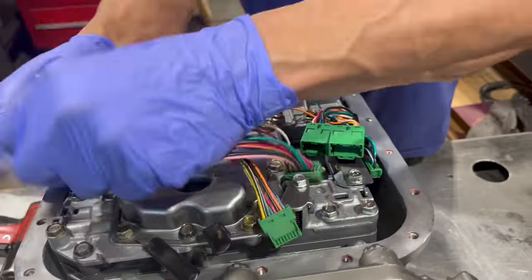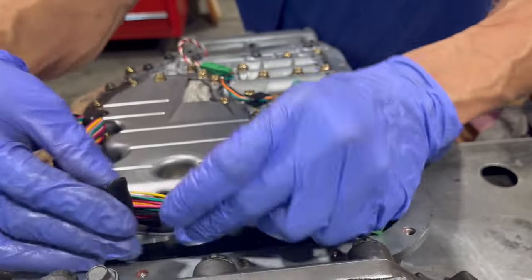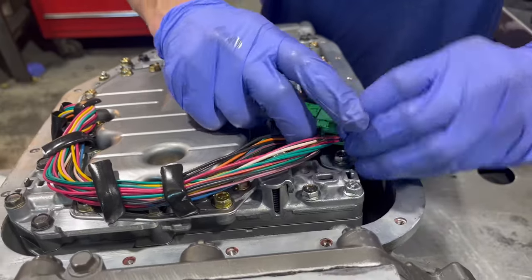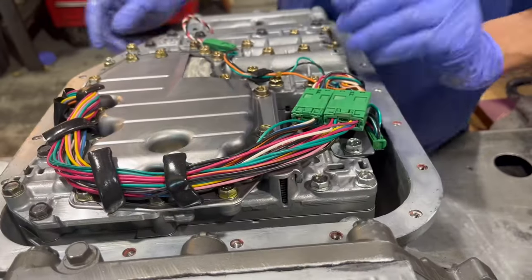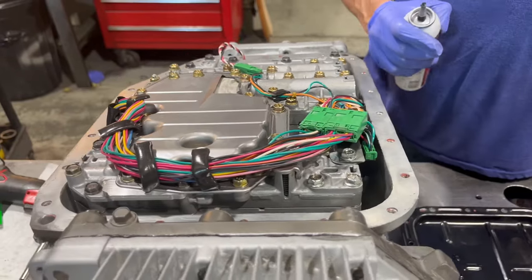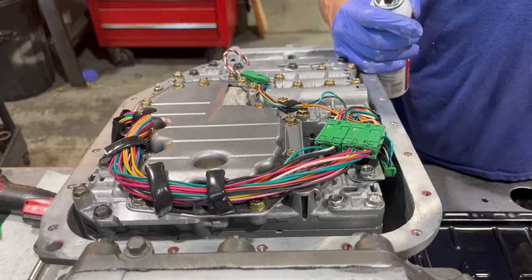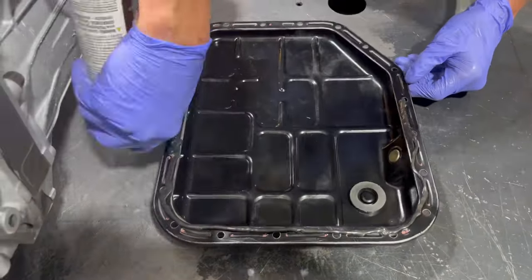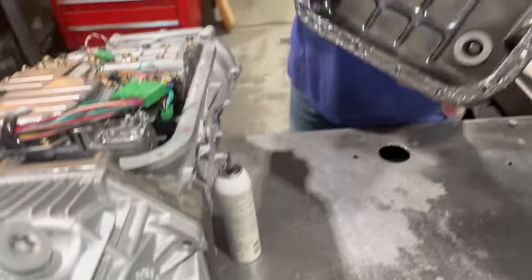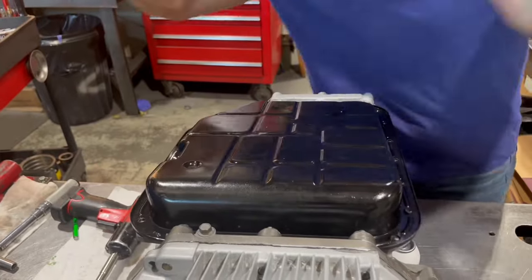This is kind of important — where you route the wiring harness, because it comes real close to where you're putting the pan on. If you route it wrong, you could crush it when you're putting the pan on, and that's definitely going to set a code. For these pans I like to do silicone — there are gaskets available, but they came from the factory with silicone and I find they seal up better that way. Now we're getting ready to button this thing up. When you do this, it's best to go in at an angle like this, then lay it down.